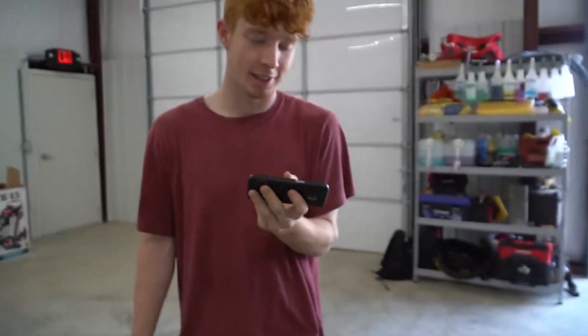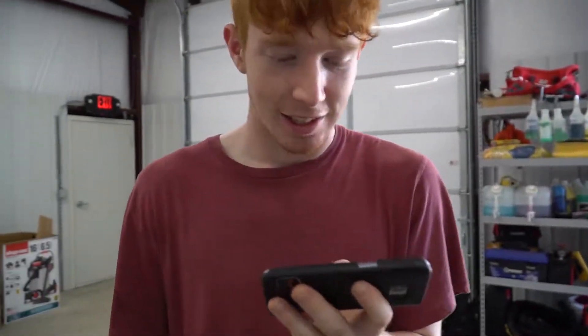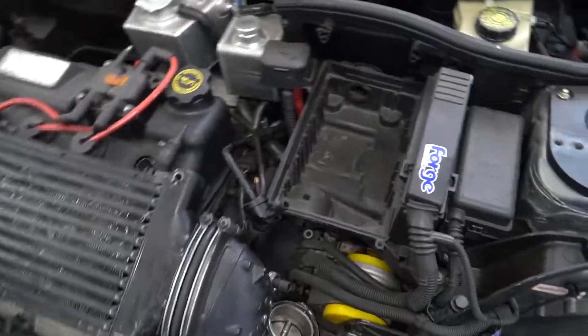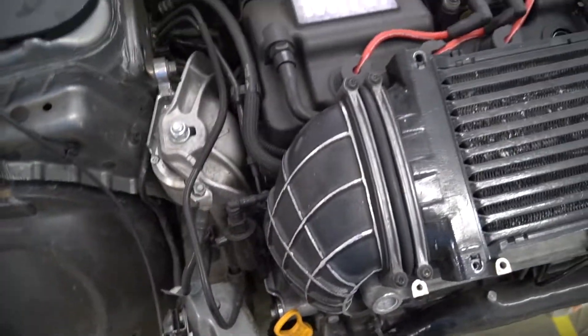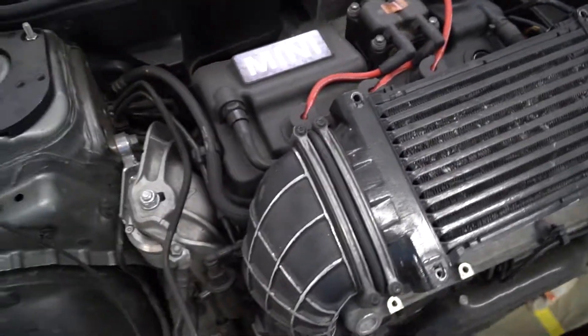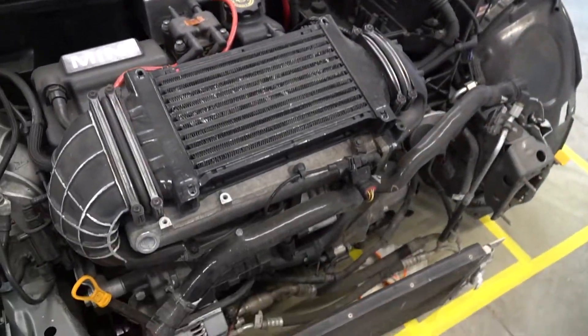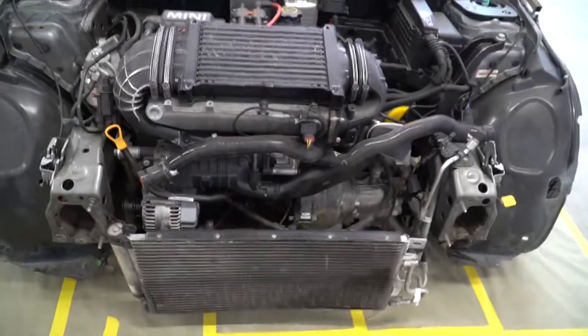Yeah, pulling my motor. And what's the issue right now? When we work on the inline six, the M54s, there's a spot where we can put our factory tow hook and cherry pick the motor out — super easy. With the Mini Cooper, there's not a spot to put the cherry picker. What we're thinking about is dropping it from the subframe down, but even then we don't know what we're gonna do to pull it and move it around.